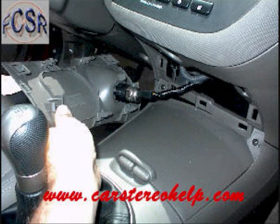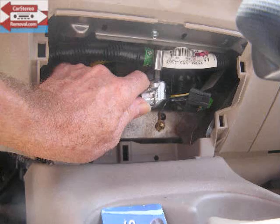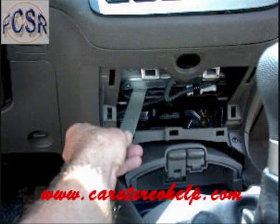There are two 8mm bolts — these bolts are usually silver. If you follow the bottom of the radio back into the dash you'll see these two bolts; they go straight up and they are also a Phillips head. Usually the socket works better on these. Remove these two bolts.